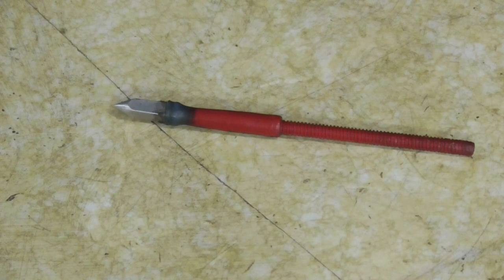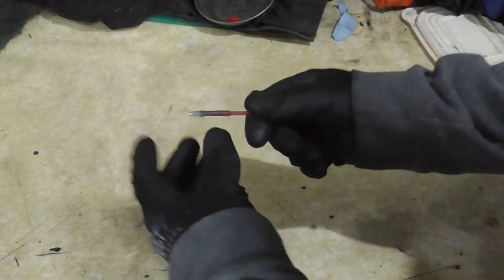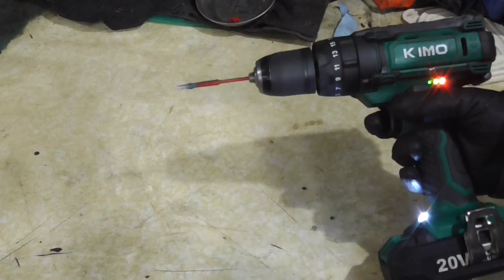Here's a look at the tool I made — it's for honing the seat. The idea is to hone the seat so you don't have to waste time pulling the seat out, which takes about five to ten minutes, and putting in a new one. Also, the cost of that part nowadays is almost as much as an aftermarket carburetor. The way this works is the tool chucks up in a drill.